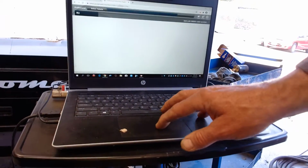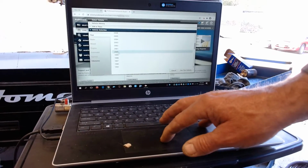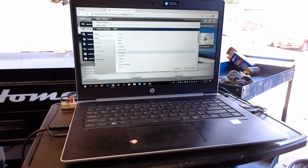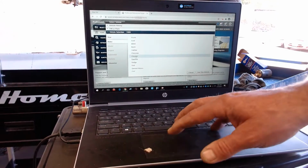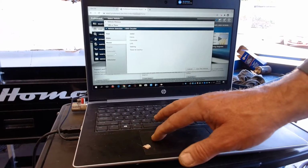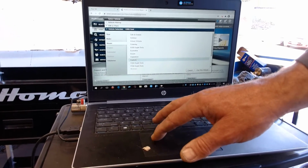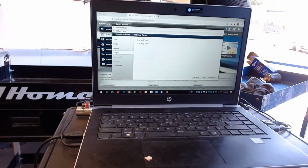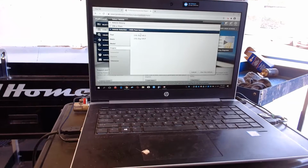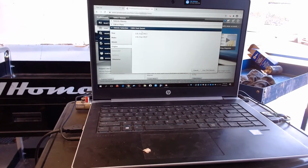And this is a 99 Ford Escort. Now look, you guys, this is the part where I know as a teenager, like, how do I find stuff? Where is things? How do I figure this out? Watch closely. Go here to Ford. Go to Escort. Go to 2 liter. Is it VIN 3 or VIN P? I'm going to look at the VIN number. And it's a P. The 8th digit's a P.